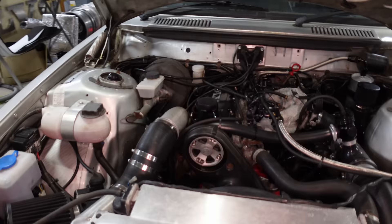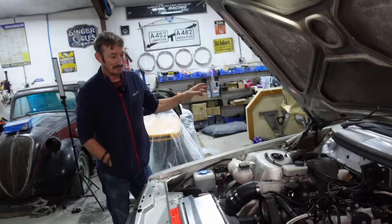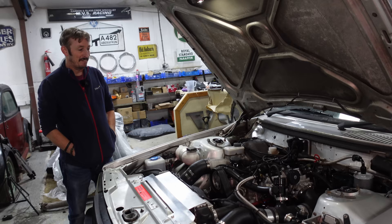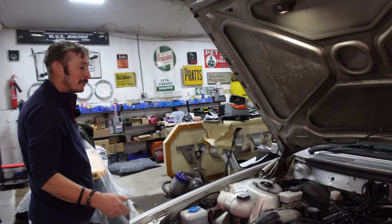Over the time Monica was in the body shop, I parked mine up at the same time. I had a donor car - a 1996 940 turbo, 2.3 turbo - squirter block. I rebuilt the block with new pistons, rings, H-beam rods, main bearings. The whole bottom end has been done, and I built it from the bottom upwards. Managed to get my hands on a 531 head, and I've ported and flowed that - more on the exhaust side than the intake side, but both sides have been port-matched. You get super smooth flow in and out.